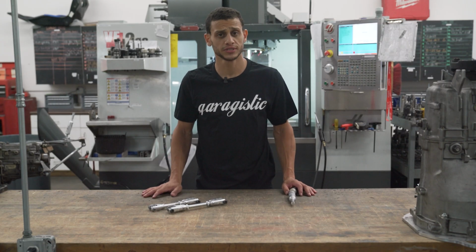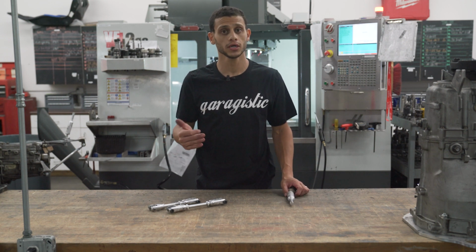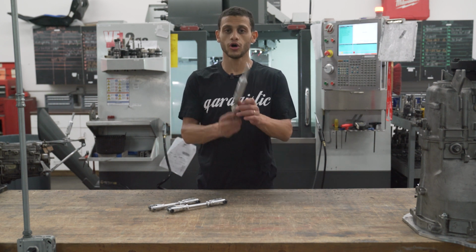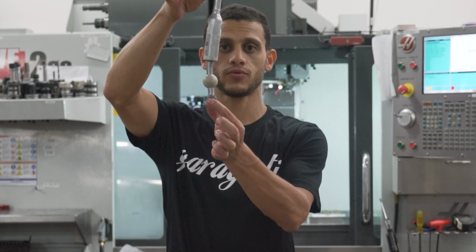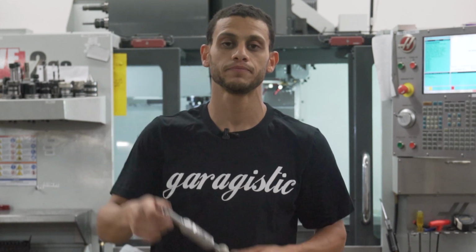The reason you have an adjustable DSSR is for a couple different reasons. You either have a motor swap in your car, or you have an aftermarket shifter, could be like our Supreme or our solid mount or any of the aftermarket ones. They're always straight instead of angled like the factory. And this angle difference, if you can imagine a straight one, that little difference right there is why you would want an adjustable version of it. And they're cool. That's why you want one.